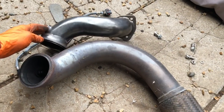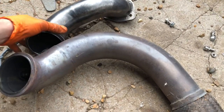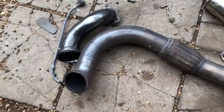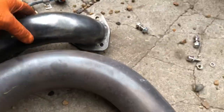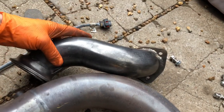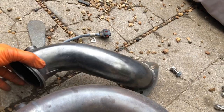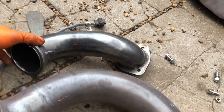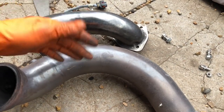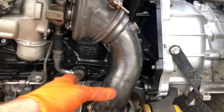It's quite a big difference between a 2.5 inch and a 3 inch exhaust, and that's why it helps with the turbo flow. Especially on these little turbos you need to get as much back pressure out the back as possible. I've got a full 3 inch system to put on in the future. For now I like the sound of the 2.5 inch - they're a little bit less droney and on boost they scream quite nicely. The 3 inch is really noisy and gets droney - you have to put a lot of resonators and silencers in it.